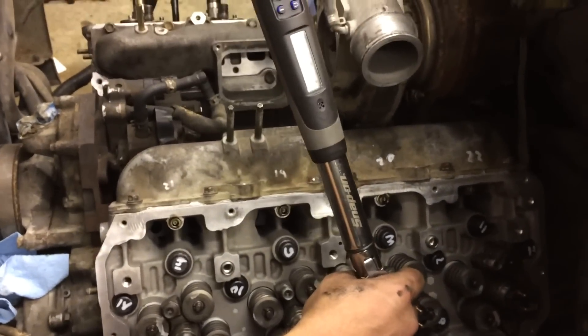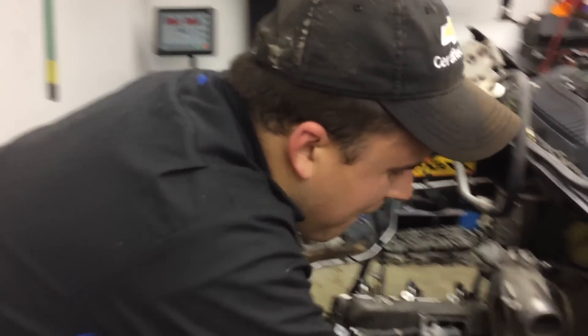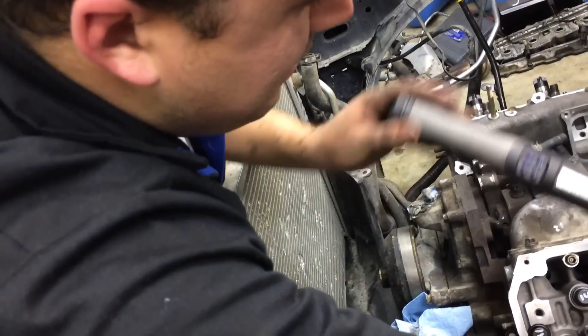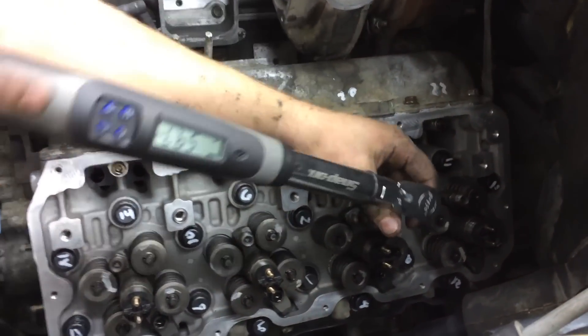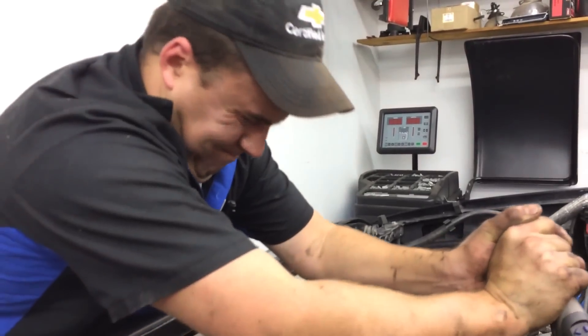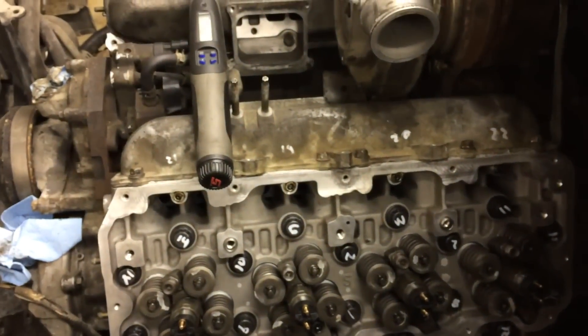Gets tight. He's feeling a little worn out, but he's got one more pass to go. You're almost there — four more degrees. Ain't no power stroke, guys. 6-0, guys. Did you do one? Yeah, that's the first one I did — and you did two as well. You know the song we need to be playing right now is the final countdown. Three more degrees — there you go. Final head and the final small bolts on top, and then both heads are on.